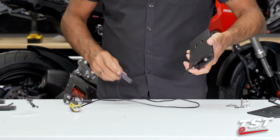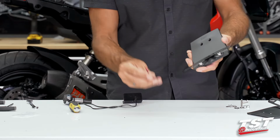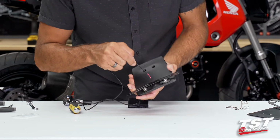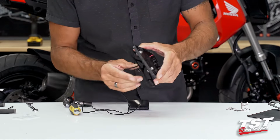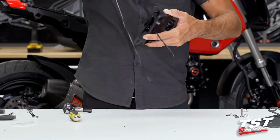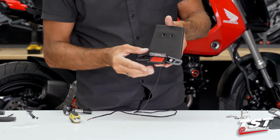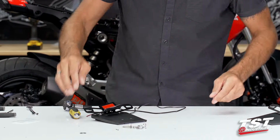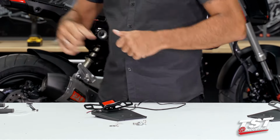We will want it to sit on the outside here and get clamped by the license plate itself. So we will go through this center triangle and try to go right through that hole that we drilled for access of the wire straight to the top side of the undertail. And in consequence, we will get this kind of a setup. Then grab this pre-assembly along with all the mounting hardware that attaches it to the bike, hop on over to the bike, and let's finish up.